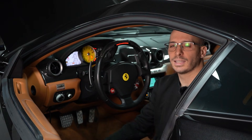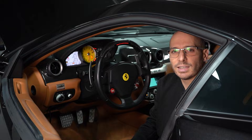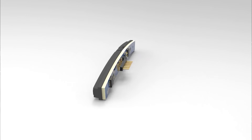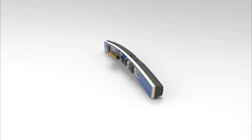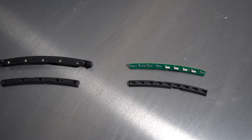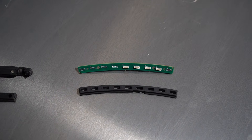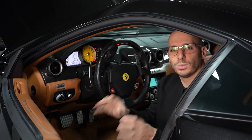One of the first things I noticed when we got this car were these five boring red shift lights. I thought it would be really cool if we could turn that into an RGB CAN shift light module like what a MoTeC has. It ended up becoming a really big project. I bought an OEM shift light, we 3D scanned it, designed a PCB. It ended up snowballing into a huge amount of work, but I'm really happy with how it turned out. You can see right now the RGB light is doing this red breathing effect when the key's on.